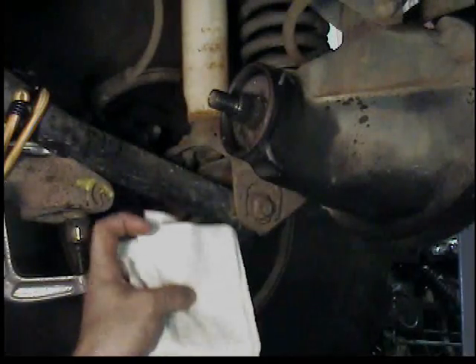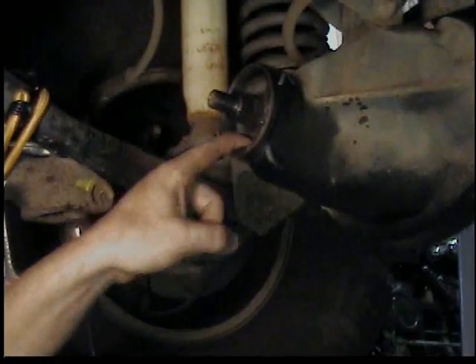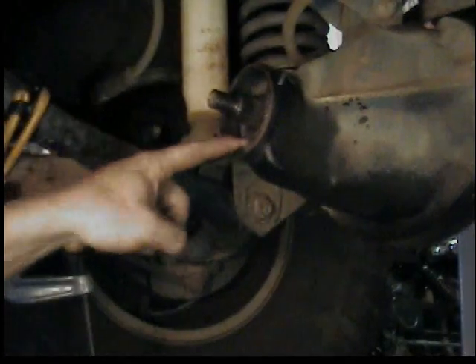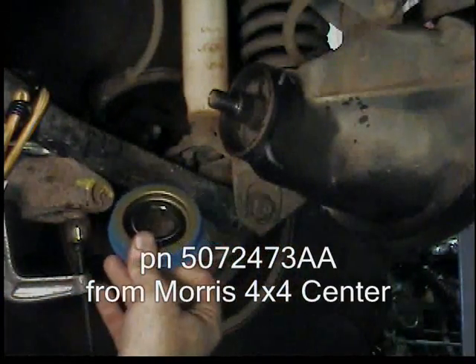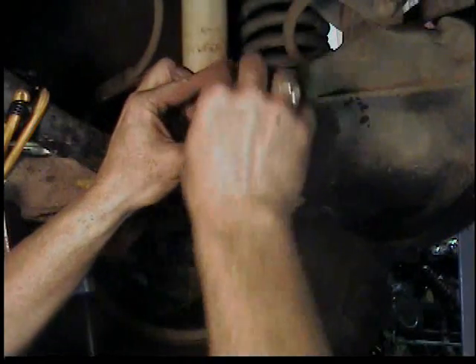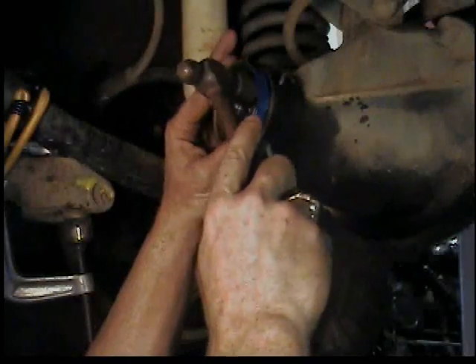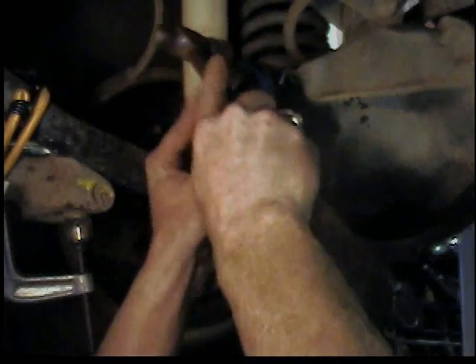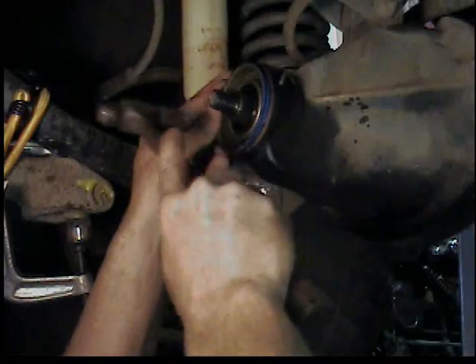Back to the pinion side — clean that up. Now it's not dripping because you drained all the fluid. Put a little black RTV on the surface where the seal is going to go, then put your new seal in. Make sure you lube the seal on the inside of it. I forgot this time so I ended up just lubing the yoke instead — that works too. Tap it in with a hammer, working around in a circle a little bit at a time with small blows. Don't bend the case on the seal. You'll know when it gets all the way in — you'll hear it; it'll sound different, tapping on the case instead of the tin.